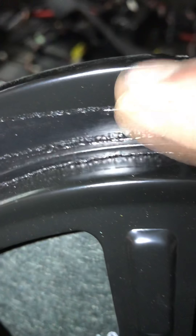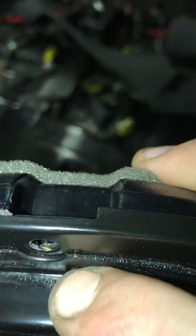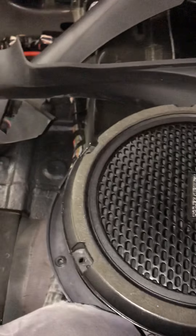You can see this glue here, but it's not as strong. Had I stuck my screwdriver down and tried to pry just the speaker itself — after I got all of these screws here around the grill — then the whole speaker... see, this is the case, the speaker sits in there like this. You can see these bolt holes right here inside of the case. The screws went through the speaker grill down into this piece here, all the way around the speaker.